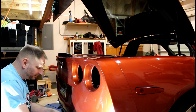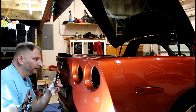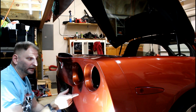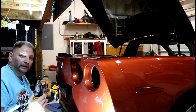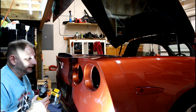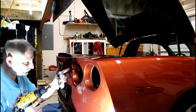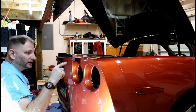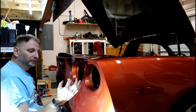Alright, here comes the part that people hate. You're going to need to get this connector through the trunk wall here, because it's got to go from the camera to that. Luckily, they give you a nice pretty little hole saw, and if you're just going to, just drill away. But unless you look just in between these two taillights, on this wall right here is a grommet. It's about this big around. The grommet right there.